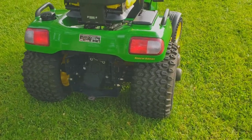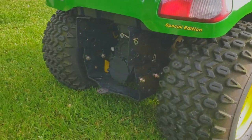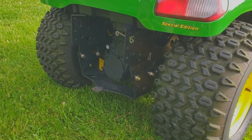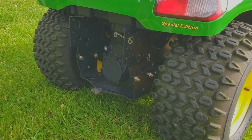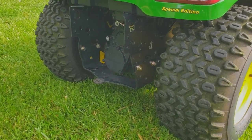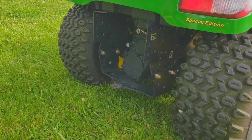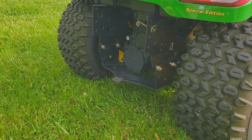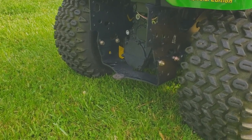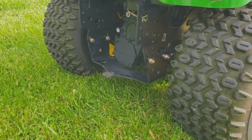Your trailer's angled down. So with all those mounting hole options, what I think I'm going to do is make me a bracket to go from side to side and bolt in, and put one of those little small receiver hitches you can buy, to where I can stick a receiver for a 2-inch ball or 2 5/16, depending which trailer I want to move, where it'll be up higher, closer to a normal height like a bumper of a pickup. So this is good for a yard trailer and little things, but it's just too doggone low for a regular trailer.